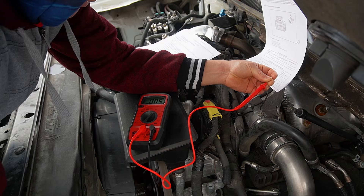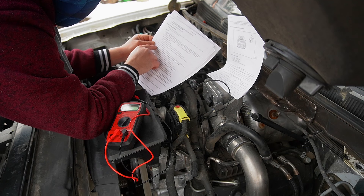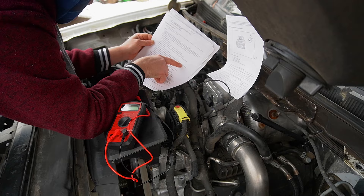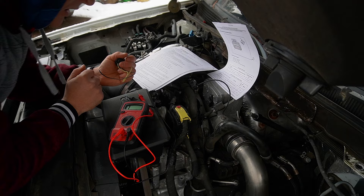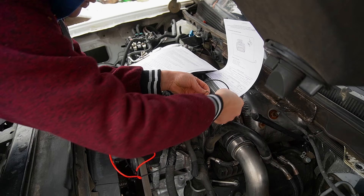Less than 10 ohms, so we skip this part. Next step: ignition on, vehicle in service mode, verify that the test lamp illuminates between the ignition circuit terminal 6 and ground. That's where my test lamp comes in handy. I'll go turn the ignition on. Number six is the last pin — let's find ground. I'll use the turbo body as ground. It's working! So far two tests passed.